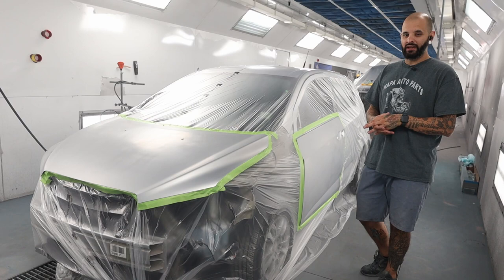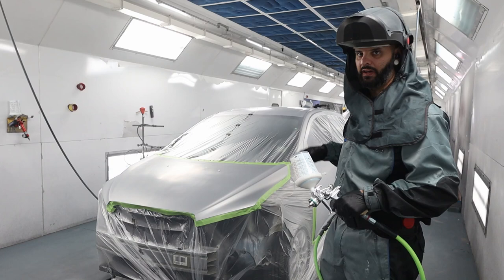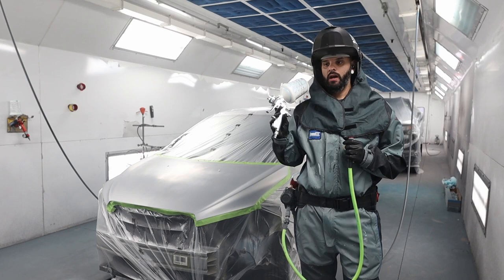I need to get the new fender sealed and I have some other stuff in the booth to get sealed up, so I'm going to do that, mix paint, and bring you guys back when I have paint in the guns and we're ready to go. I have some paint mixed up and we are ready to start our blends. I got sealer on the fender. I'll show you how I spray new parts with Ultra 9K, especially with silvers.